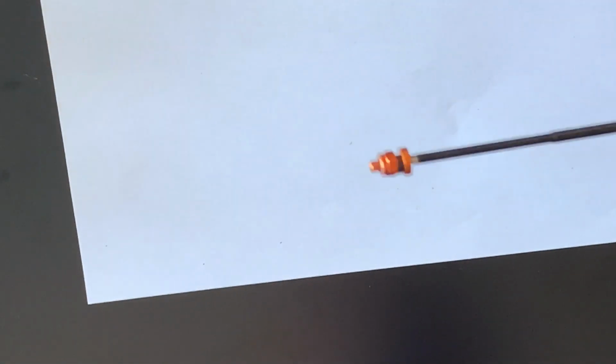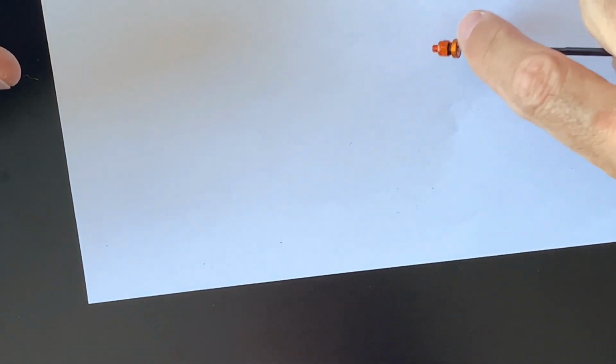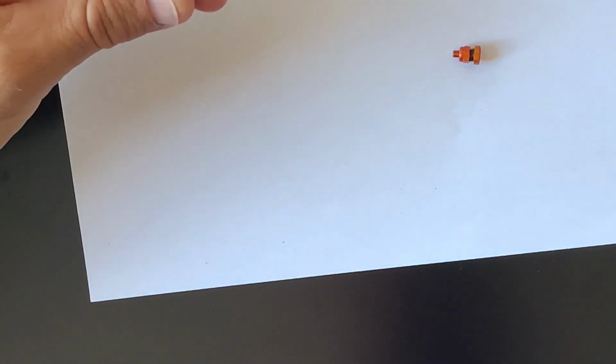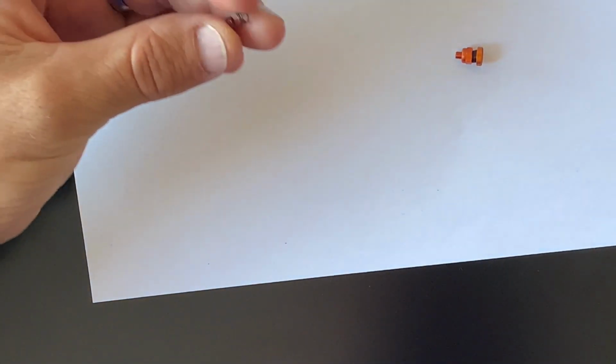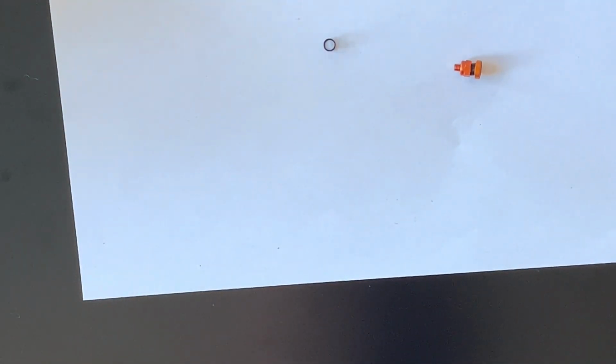And then I'm going to leave that for a day. So it's completely loaded. It hasn't compressed through a shock, because when you compress the front end of a 12 scale car or a GT12 car and the spring compresses quickly, it's overloading the spring, and that's why it compresses. So that's a great little tip to stop your front springs compressing.